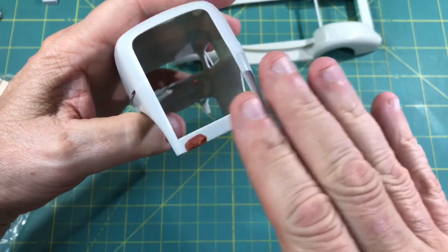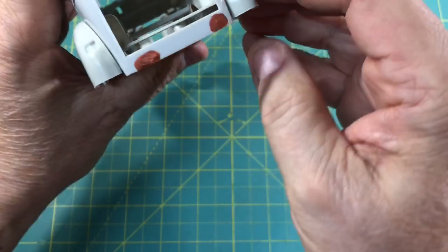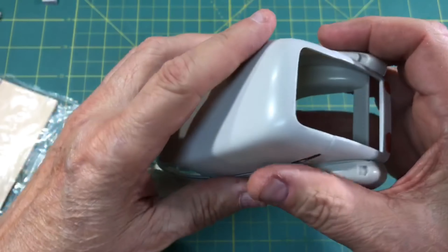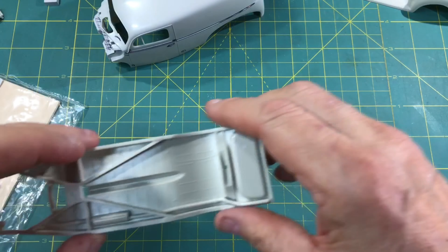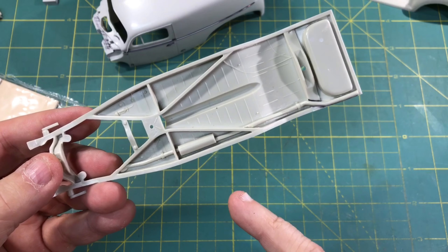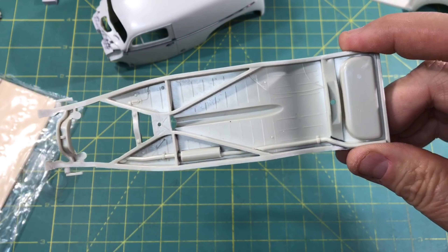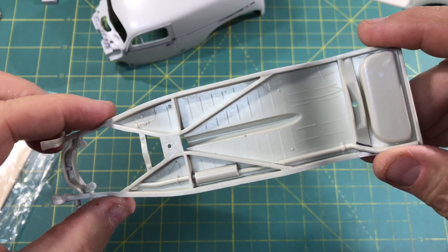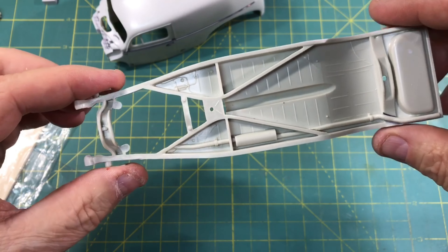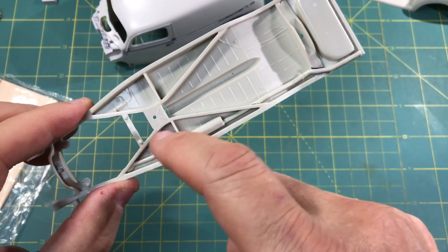I did go ahead and open up the grille a little bit — I've still got some finish sanding to do up in here. This one had a little bit of a dimple right there, more of an injection issue — easy fix. I'm going to put some plastic in these grooves where the bumper guards come out, because this is going to be a mild custom, so there won't be bumpers on it. Same thing on the back where the bumper mounts come out — that'll all be smoothed out. And this is going to be shortened just a touch because the sedan delivery is a little bit long — it's not even across the back of the fender.